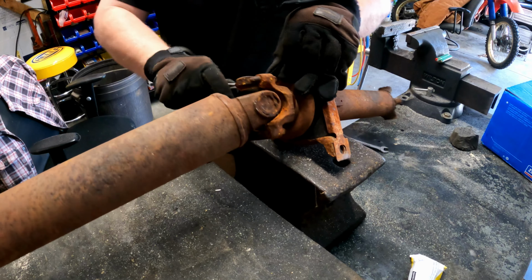Check out how I did that. That is a 2 into 1 into the single factory muffler all the way out to a single tailpipe. Man, it sounded so quiet. It sounded like a showroom new truck, but I think maybe the back pressure killed some power. We'll rectify that during this video series though. We'll do a couple of Flowmasters and maybe a couple 3-inch all the way back. Fix that.